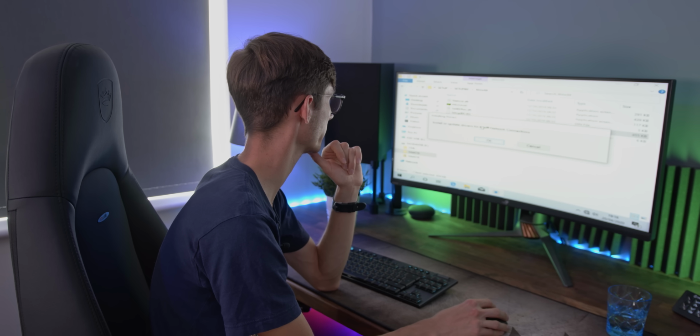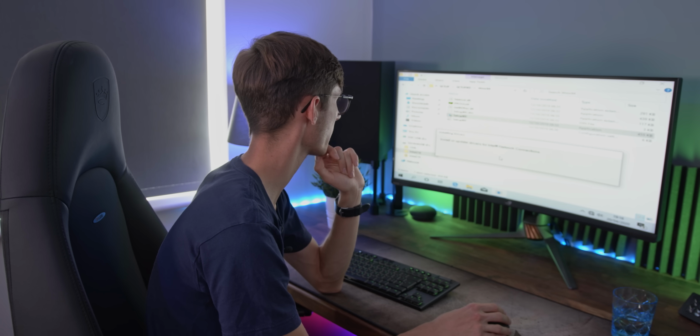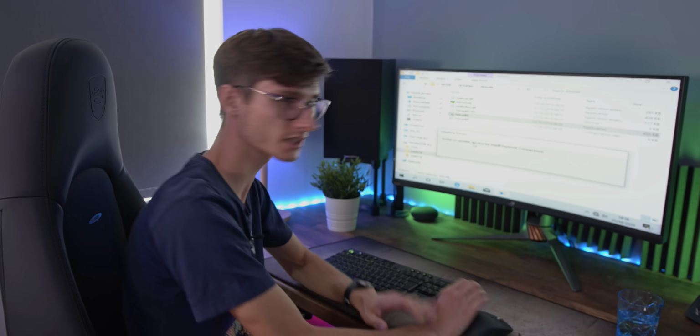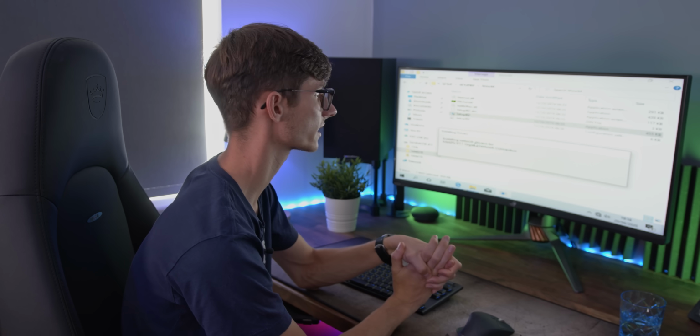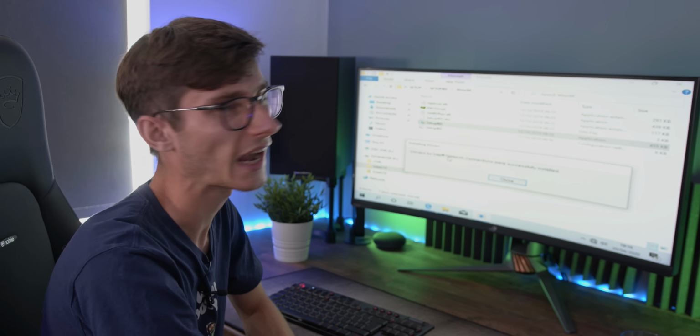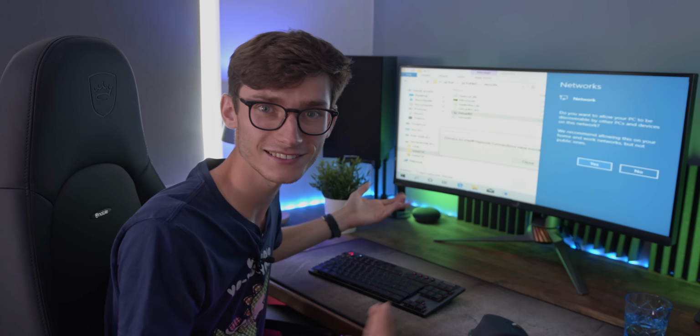so buried away somewhere in this folder, we have something called Setup BD. So just open that up and then it should say install or update drivers for Intel network connections. Select OK and let it do its thing. And then, in theory, we should be connected to the net. How to sound like a nerd 101. Hooray! We're connected to the net!